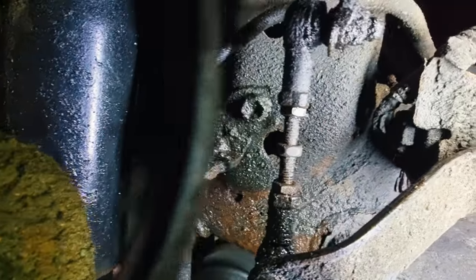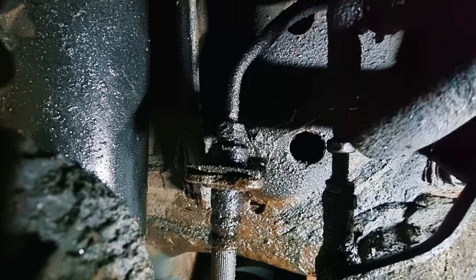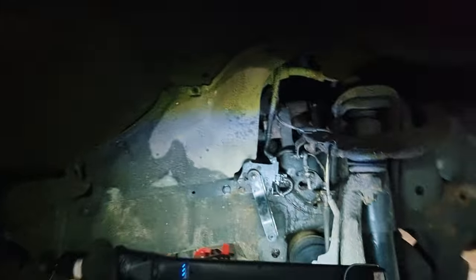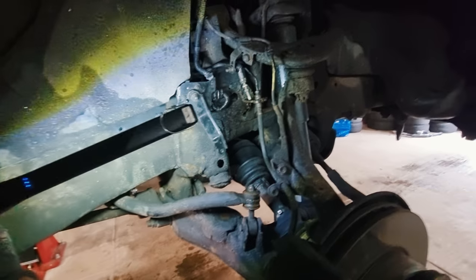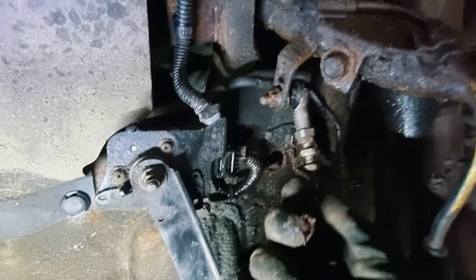The front is a little more complicated because you've got a little two-way threaded rod here. You have to remove the lock nut here and here so that you can spin the middle. What I've done on the other side, because I thought it was a little bit easier, is to just remove the bottom of the threaded rod.